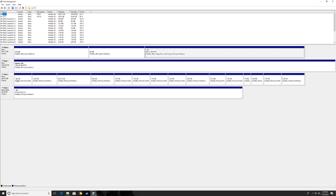In Disk Management you can see all your drives. The 465.76 gigabyte drive is our PlayStation 4 drive — you can see it has different partitions that are listed as healthy. To format it, just click on a partition, right-click, and select 'Delete Volume.' It will warn you that the partition was not created by Windows and might contain data recognized by other operating systems. Click yes to delete it, and it will turn black as unallocated space.